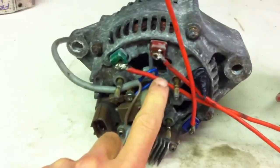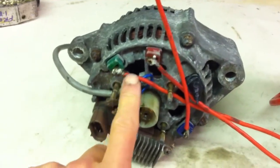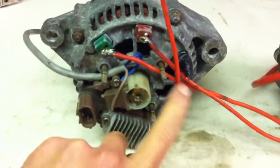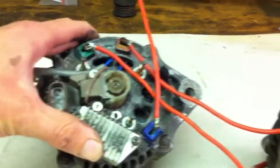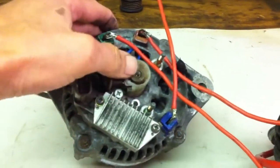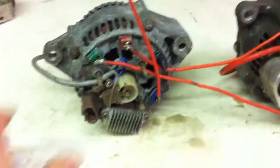The wire is about two-and-a-half millimetre — it's an imperial standard, I think I may have borrowed it from my dad who was an electrician. I soldered it with a small gas torch. So that's how you convert one of these motors — the three phases go off to the controller and 12 volts goes onto the rotor. Finished.